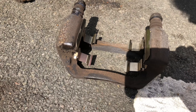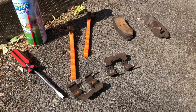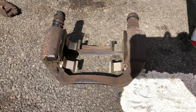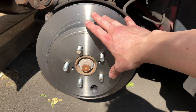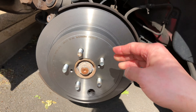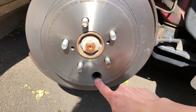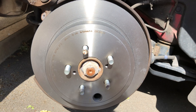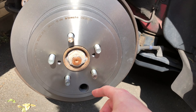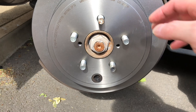I've replaced the brake hardware with new Brembo pieces and they seem to fit in place pretty well, unlike the problem I had with the front. Now it's time to install the new disc drum. Note that the disc drum needs to be installed and the parking brake correctly set before bolting the caliper carrier back on, because this hole needs to be plugged from the inside. We need to adjust the brake shoes to the correct point, then pull the drum back off, install the rubber plug, push it back on, before bolting the carrier back on.